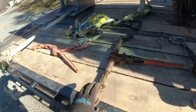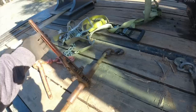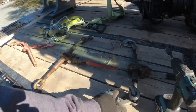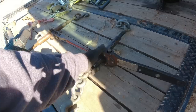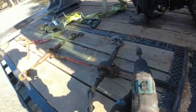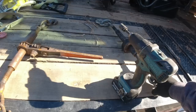These ratcheting chain binders are probably one of the best, more convenient routes to go - guaranteed tightness, you can pull harder with easier leverage. You just hit this little release and you can back it off. You don't need anything extra - this is just you, your power, and that. Adjustable, works great. This here is something of the modern-ish age. If you're familiar with bigger trucks, your brake adjuster, your slack adjuster - that's pretty much what that bad boy is in there, except somebody retrofitted this thing and you take a drill gun to it now. That thing is very convenient. But this was what I ran for a couple years before I was introduced to speed binders.